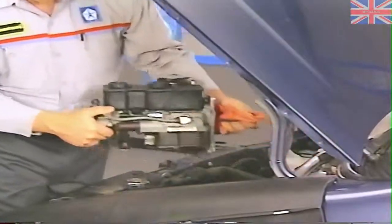Replacement of the piston assemblies is basically the same for both systems. We'll be performing the procedure on an Antilock 10 hydraulic assembly, noting any differences you should be aware of for Antilock 9. Step 1 is to remove the hydraulic assembly from the vehicle. Be sure to depressurize the accumulator first by pressing and releasing the brake pedal as discussed earlier.